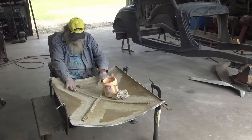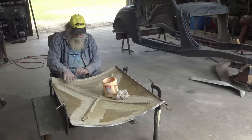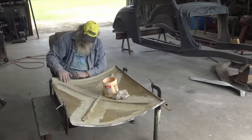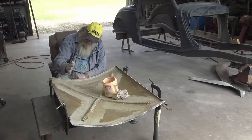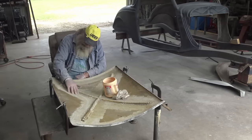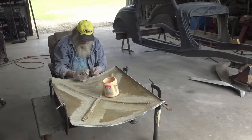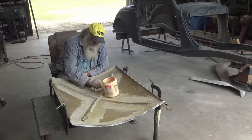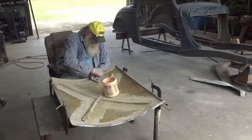So I got my truck lid there, got it kind of squoze together where it gets the arch like I want it. I hit it with 60 grit flat wheel on the side grinder. I hit it with a 60 grit on a Dremel to try to get a mechanical bond, because I understand that you can't get a chemical bond because this here is too old, so I got to get a mechanical bond. So I got it roughed up really good. And as my buddy in Florida that does fiberglass work says, you get it ground down good and you wipe it with acetone, and then you pray to the fiberglass guys that it's gonna work. So that's what I'm gonna do.